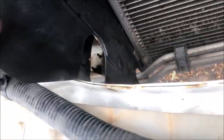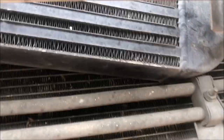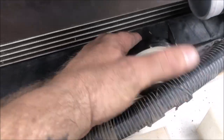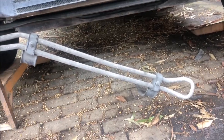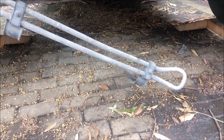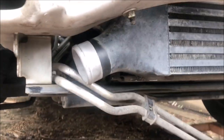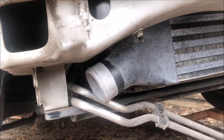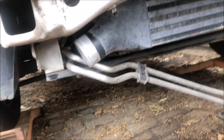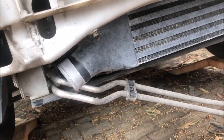This plastic shield comes off as well to allow for the pipes. This is a power steering cooler — believe it or not — and it is in the way of the intercooler. I was actually able to mount the horn back in there once it was all in, in its factory position, which is fantastic. The only thing I haven't worked out yet is this cooler. Is it even necessary if it's only for the power steering? I'll have a look online. Also, there was a bit of mucking around because I'd been shortchanged a lower intercooler pipe, so I'm going to have to source one of those. I've got an idea where I can still use this cooler — trim it up and reroute it somewhere else.